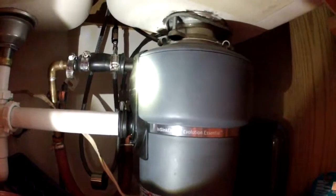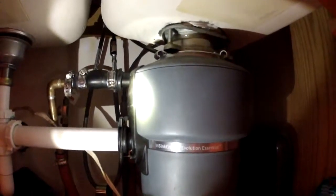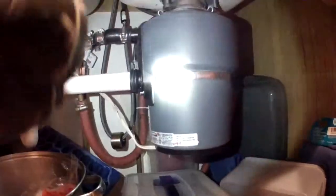And you can see my other video on how to get your dishwasher to drain, on what that looks like when water is running through here from the inside of the sink. I'm not going to take all that apart today, but that's where it runs, and that's how you get to your drain hose. So you can simply remove your dishwasher with the power off, with the water off, and drain your drain hose, pull your drain hose out, and replace it.